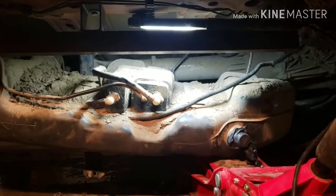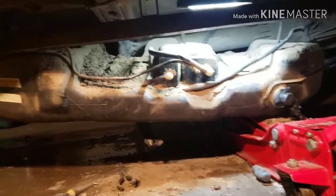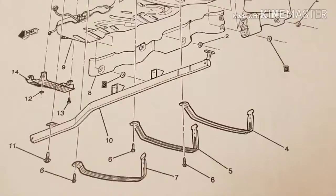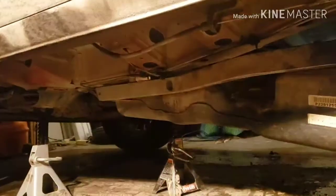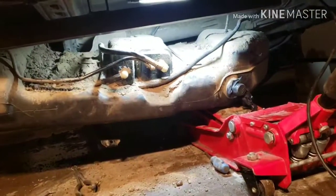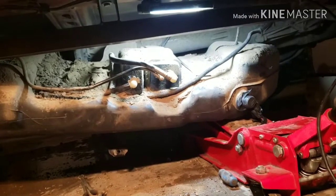And yeah, it's a struggle to drop this fuel tank down. Basically, there's what, 1, 2, 3, 4 straps. I got the third one from the back loose, and then the fourth one up on the front has never been touched, just hanging. So basically just tilting it down and work your way out from the back going to the front.